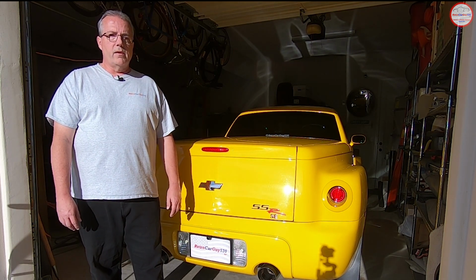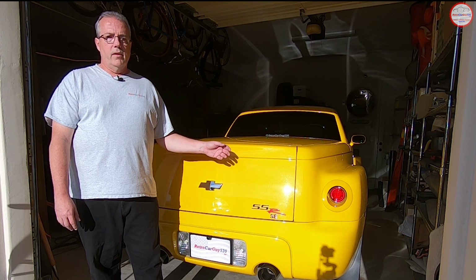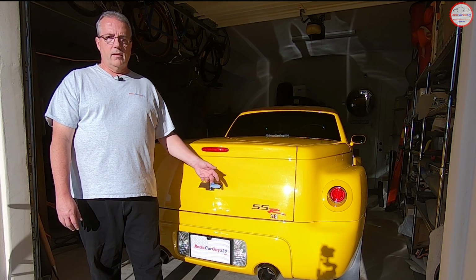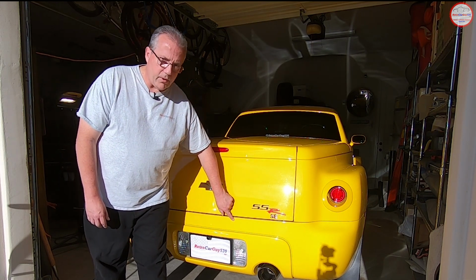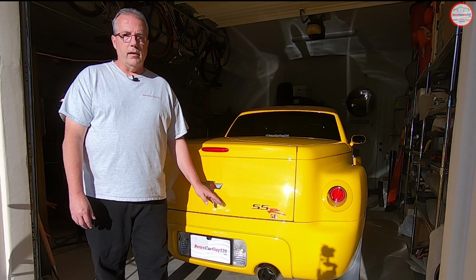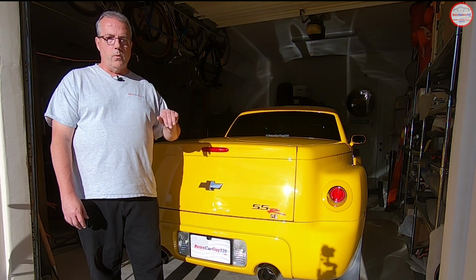And then also the bumper fascia itself, it acts as a scoop. It seems with the airflow from driving the vehicle and the water being sprayed up from the road and the tires, water comes underneath, and it acts as a natural scoop to bring the water up. It seems to come all the way up here. The bumper fascia actually sits on top of the bottom of the cargo area in the rear of the vehicle, and there's enough of a gap there to let the water in.